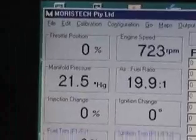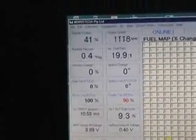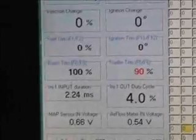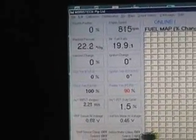That is precisely what I wanted to see. Vehicle is idling at 700 RPM. If I get a little bit more, there's the air/fuel ratio, injector cycle, etc. Fuel mappings are over on the right — nothing in it yet. Give it a bit of a tickle — you can see the yellow, that's the current fuel map being used. Injector duty cycle — certainly plenty of overhead room for the supercharger.